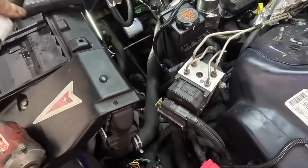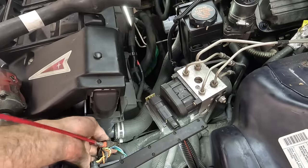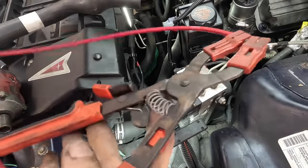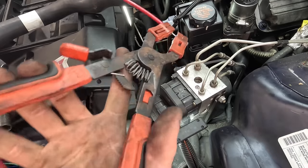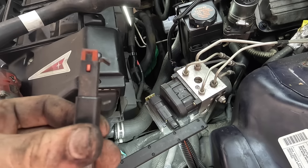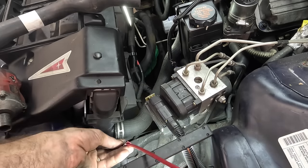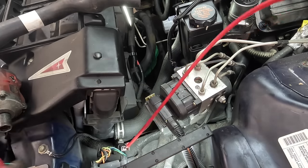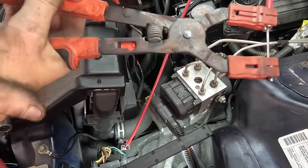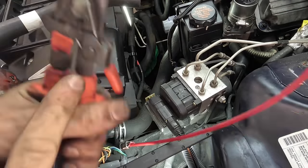We'll slip the new hose in position and clamp it all down. Our clamp is kind of pointing away from us and down, so I'm gonna go in with this cable clamp tool. It's basically a kind of set of pliers on a cable with this little mechanism right here, and that's designed to squeeze that clamp to release it. Go ahead and give it a squeeze. The clamp is now open, and these are supposed to lock in.